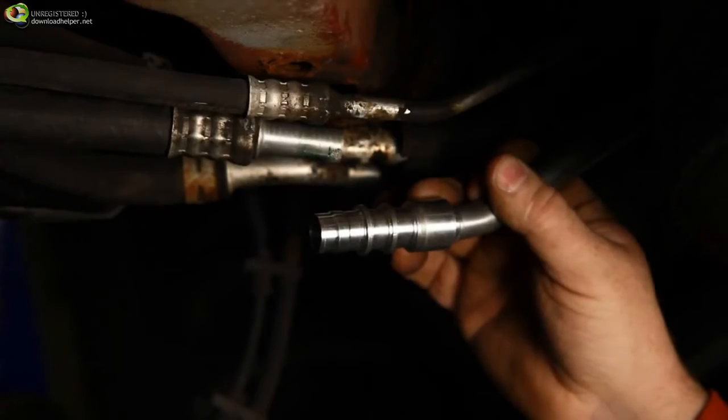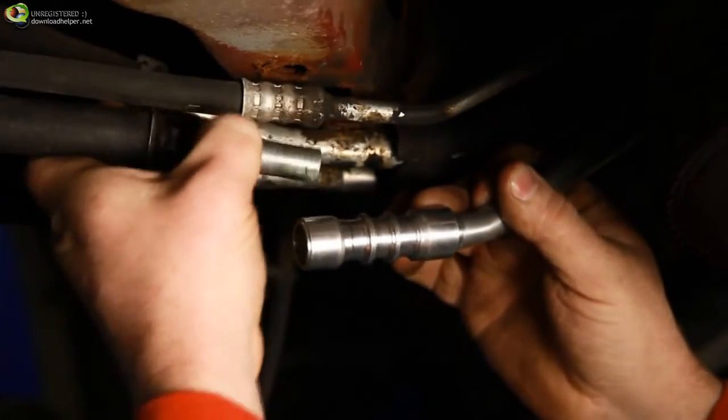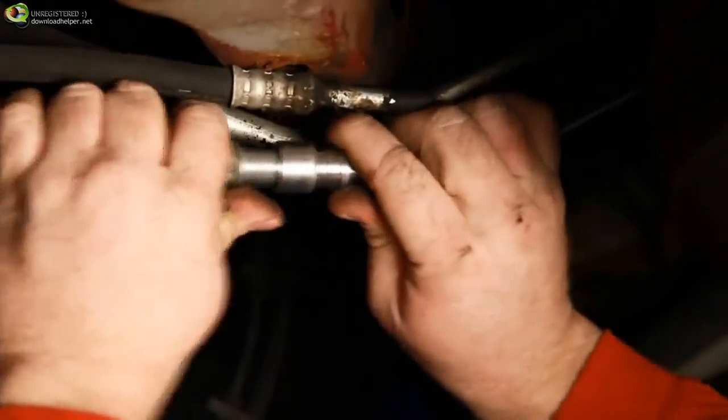Next, gently rotate the cross drive screw counterclockwise to loosen and slide the SWEDGE-LOK tool off of the assembled SWEDGE-LOK union. To complete the splice, slide another collar over the unclosed end of the union body with the step portion of the collar pointing away from the body. Insert the remaining tube end into the body until it completely bottoms out in the SWEDGE-LOK union. At this last step, external pressure may be required to hold the tubing in place.